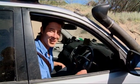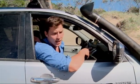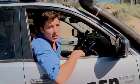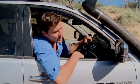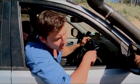Okay, I'm not actually sure if I'll get out of here, but the first thing I notice when I hop in the car is that it's not in low range. So what I'm trying to do now is slowly rock the car back and forwards, and you just get a small movement each time until it builds up and up. Now this is much easier to do in a manual vehicle. It's one of the few advantages that manuals have over autos.